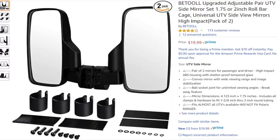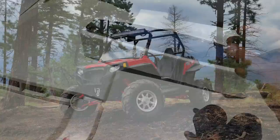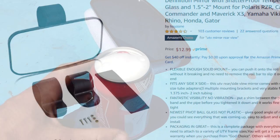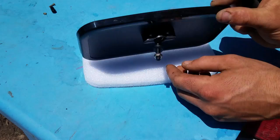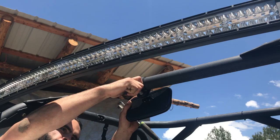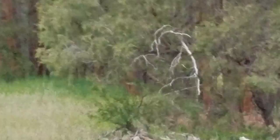I got those side mirrors mounted up and they work really well from the driver's seat. I was going to install this sweet looking 15 inch rear view mirror, but I forgot it only has a mount for a 1.75 inch roll cage instead of our full two-inch on this Can-Am. So we'll just go with this other generic rear view mirror that has clamps for any size roll cage. To install this $13 rear view mirror, I started by popping the ball end of the included bolt into the ball housing on the back of the mirror and secured it with the provided Phillips screws and nuts. It's best to wait to fully tighten those until it's already on the bike and adjusted to the correct angle. Then I popped the included clamp onto the roll cage and secured the mirror with the included 10mm nut and washer. The wide angle of this mirror is great for seeing what's on the trail behind you at a glance, especially when riding in groups.